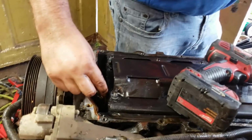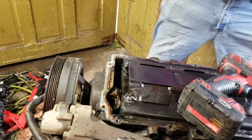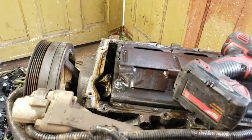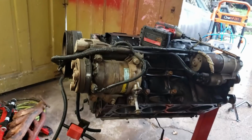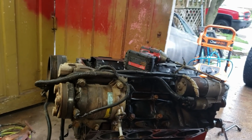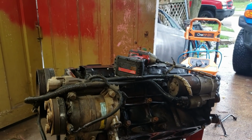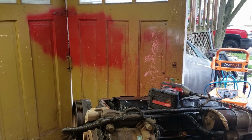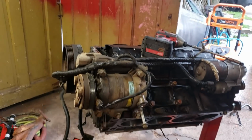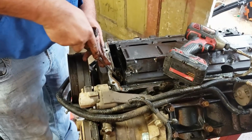What happens is it gets all blown out, and then your engine doesn't keep good pressure, and what you'll see is symptomatic of the old high volume oil pumps, where you rev it and the oil pressure comes up, and you let off and it drops, and you rev it and it comes up. That's because with RPM it's able to build pressure regardless of the seal.